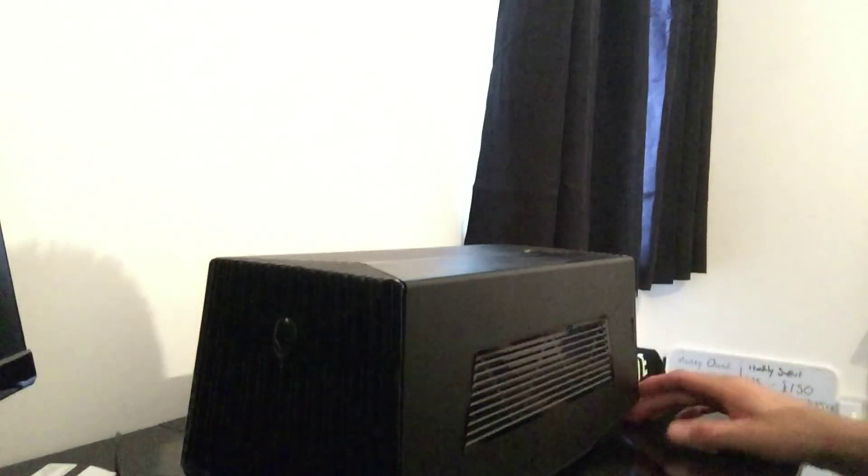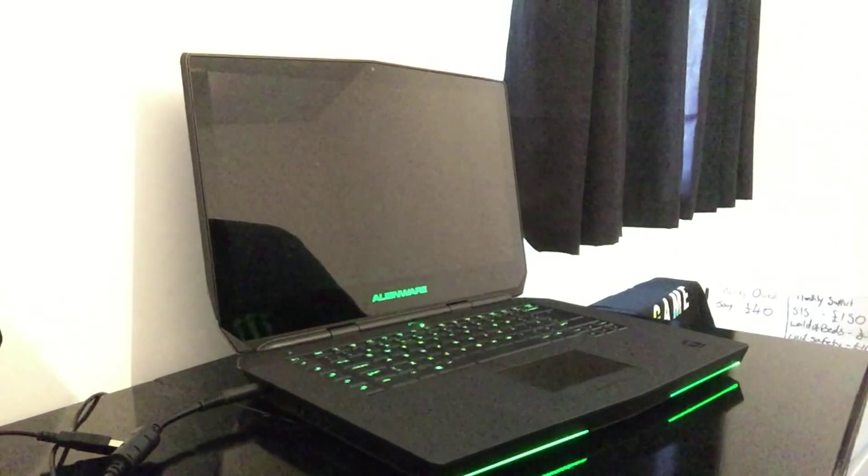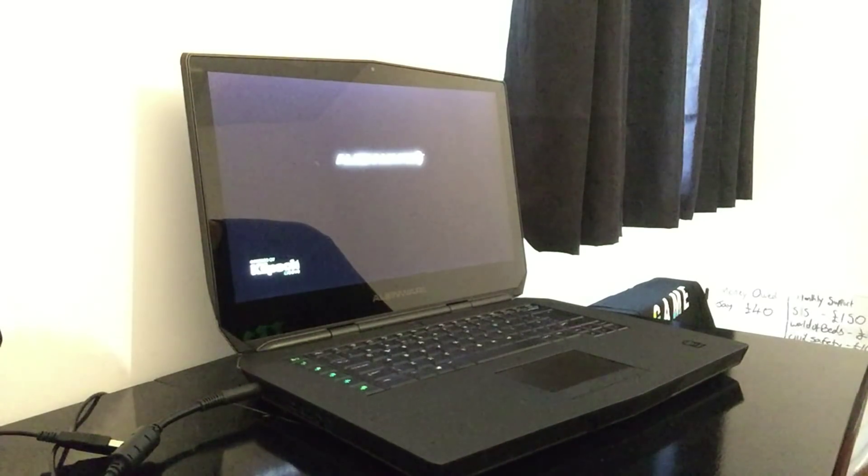So yeah, panic over — that's all fitted. I'm just going to connect it all back up and then we'll boot into it on the Alienware 15. The amplifier is back in place, all plugged in and ready to go. Make sure whenever you're connecting the amp to the Alienware that it's always off — make sure it is completely off before you connect or disconnect it. We're literally just going to boot it up and see if it goes. I'm hoping that the graphics driver for the EVGA GTX 980 is the same for the Ti version — I'm assuming it will be as they're very similar, the same model.